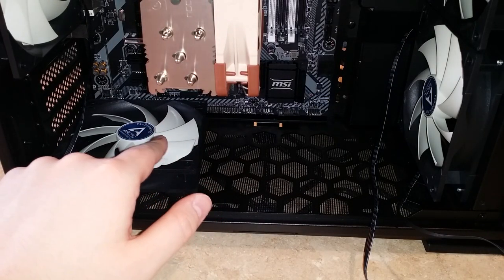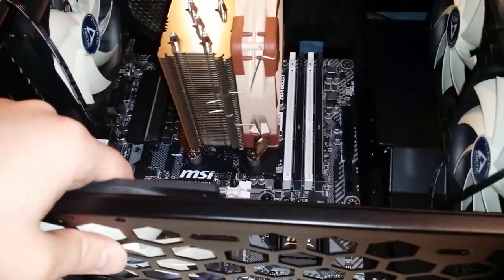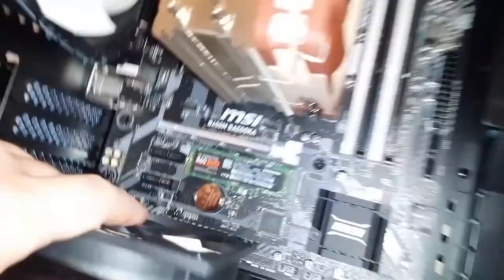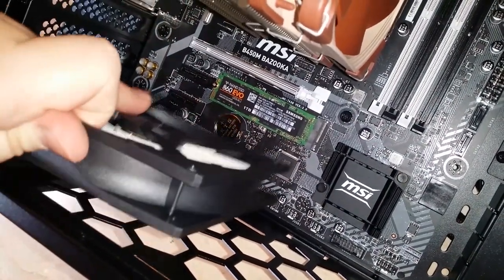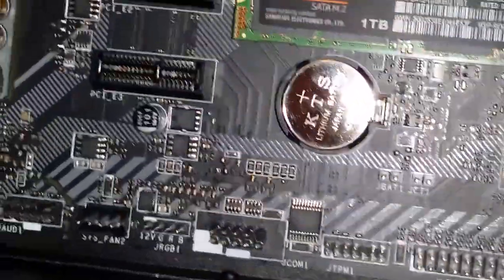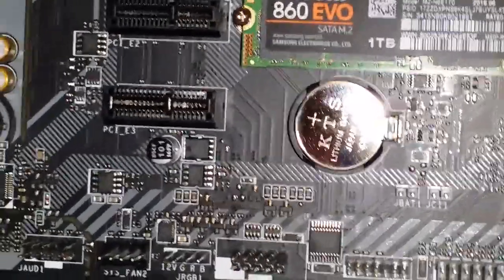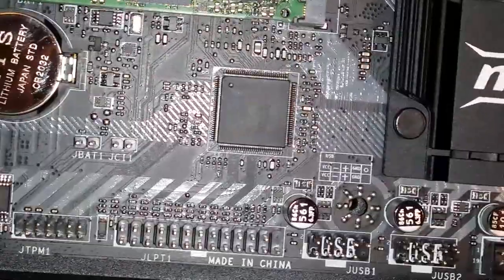As long as these bottom fans are on it should be fine. If they were off, they would obstruct the airflow going into the video card. But if they're on, it should be fine. Okay, there is a problem actually — I believe I can still put the fans in, but I can't do them just yet because at the very bottom of the motherboard there's all this stuff. That's the system fan connection over there, but also most of these connect to the front panel of the case. So I need to plug all these in before I install the fans, because I will not be able to plug anything in with the fans in the bottom.